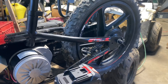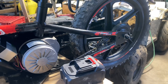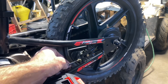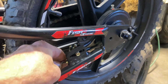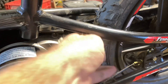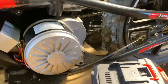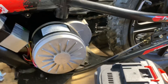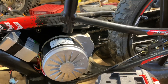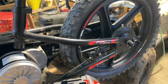The customer did ask me about a couple of things — I told him check if the chain was too tight and if the brakes were dragging. I noticed that's loose there, so we'll go back and tighten up a few things. His chain is really loose too — if that was pulling hard on the motor it would create resistance. On a smaller motor that would be the end of it, but this one can handle it. Even so, if you pull a bunch of weight on one side of the bearing it'll slow any motor down, that's just reality.